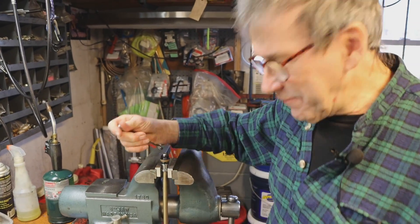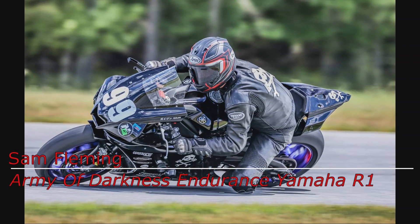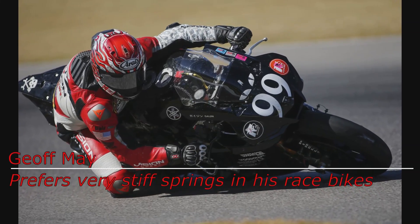This may be completely off the point, but in road racing especially we have what we call dynamic load — when we are entering a turn and the suspension components are compressing as a result of the inertia created by turn entry. In that case, we really need heavy springs because it's very hard to have the hydraulics respond to that slow movement. So we often use very heavy springs on road race bikes, which can resolve numerous problems in that area.